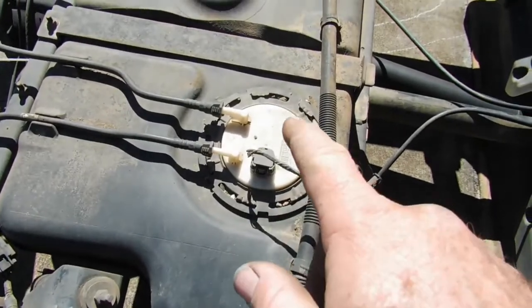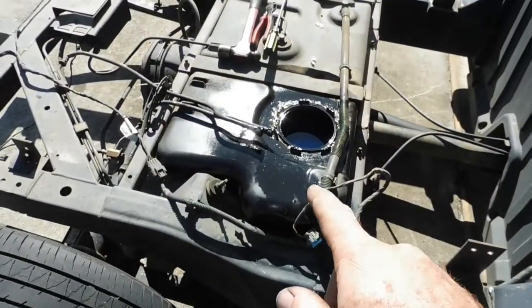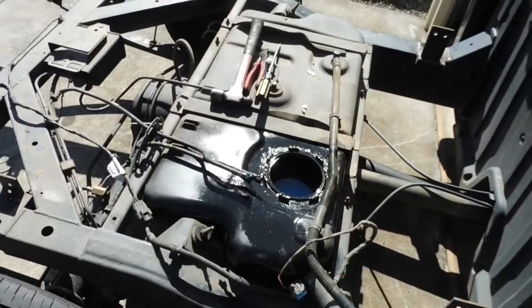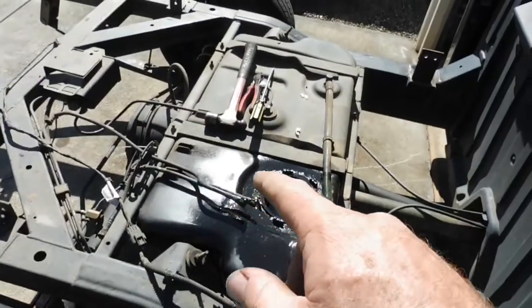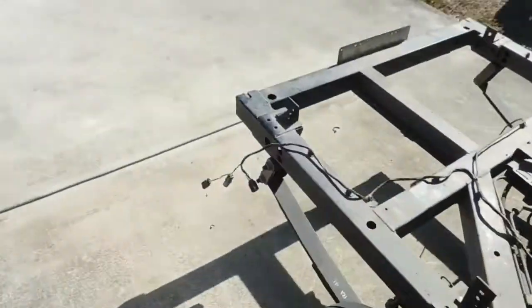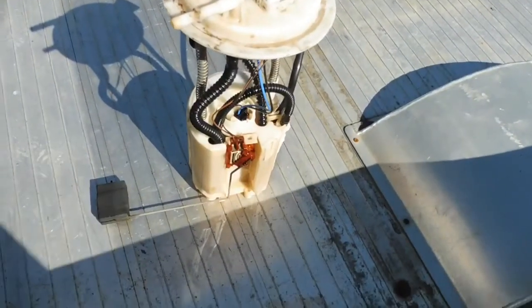So now I've got to pop this ring out and get the carrier out, and I'll get back to you. Just smack that ring with the screwdriver and the hammer, and it undoes. A couple of quick connect fittings, using the bottle lid. You can see how I do that in another video. And there you pull the hanger out. It's like an inbuilt swirl pot. We'll take it inside and pull it apart.